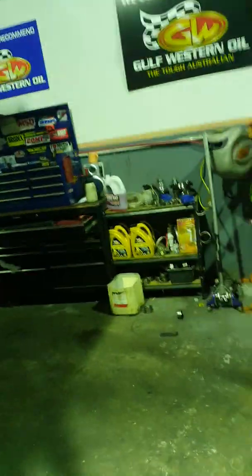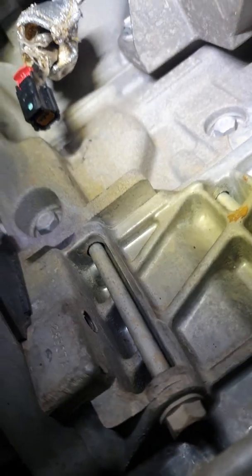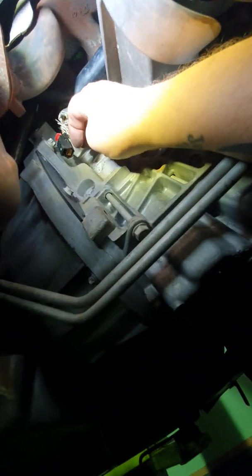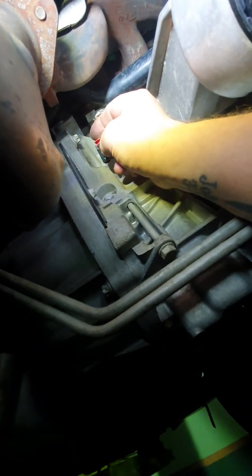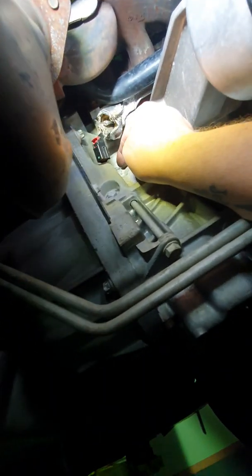It's on the right hand side of the engine block, held in with a 10 millimeter bolt. I've actually got the old one out already. The engine mount is here — let's pan out. The exhaust system is here, and the sensor sits just in here. The reason we're under here is the electrical connector points towards the rear of the car. You have to pop up the little red tag and then push in the black one. It's easier to just undo the bolt, wiggle gently, pull out the sensor, and then disconnect the electrical plug.